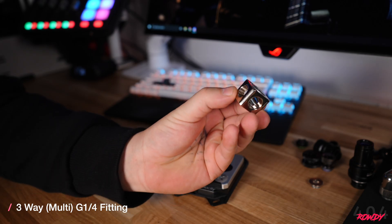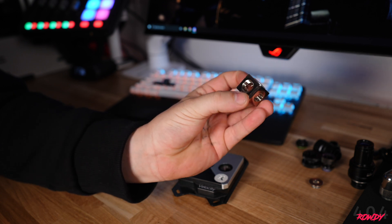Another fitting you might come across is the multi-port fitting. These are very useful and in most cases absolutely necessary, as they give you an extra line into the loop — making it easy to place a tap that you'll need to drain the coolant from time to time during maintenance. It gives you that extra port you can apply a tap to or a fill bung. I can't tell you how many times I've planned loops without drain ports and realised at the last minute that I need one, and it's yet another thing to factor into the price. Definitely useful and not to be overlooked.